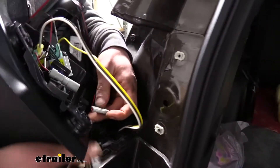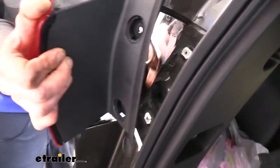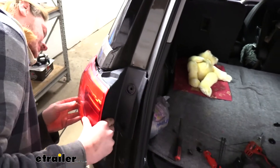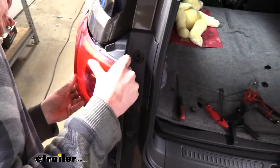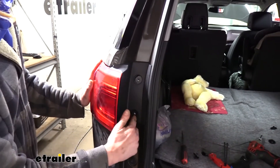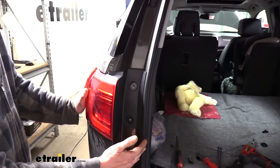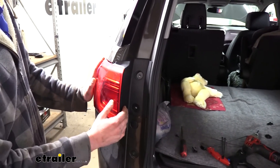We're going to plug our electrical connector back in first — it is a very tight fit. The extra yellow wire we can just poke down in there, then line up our tabs and push the whole assembly back into place. We can then reinstall the screws and caps. Then we're going to route that green wire over to the other side along with a portion of that white wire, using the same fish wire trick to pull it up.